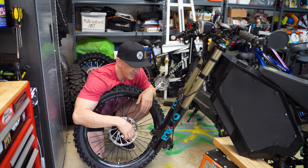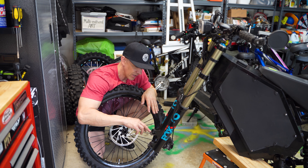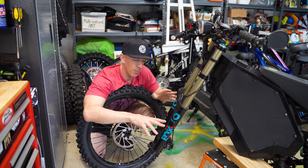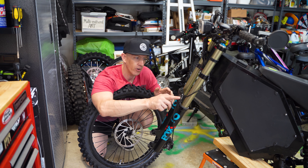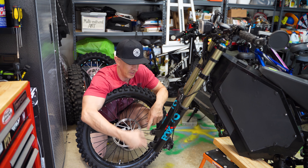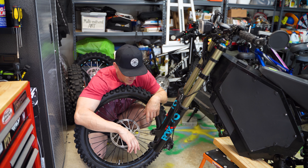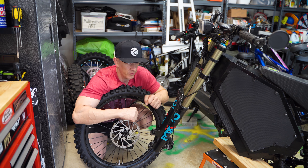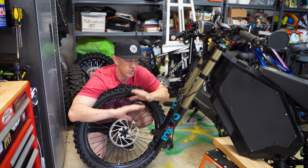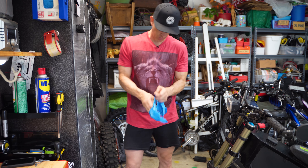When you put this back on it's important that you do it the right way. I like to tighten down the bolts on the left. On a dirt bike it's more critical, but on a mountain bike downhill fork it's not as important because you've got this center crown piece keeping the forks where they're supposed to be. But I still like to just tighten these first, bounce a few times, make sure it's seated inside the axle properly — everything spinning smoothly so there's no binding anywhere on the fork.